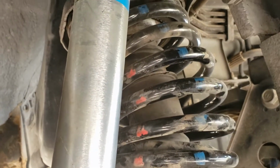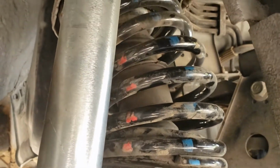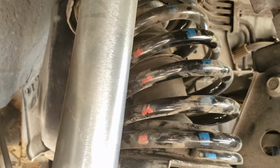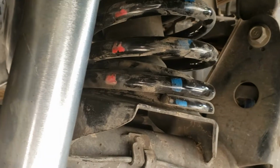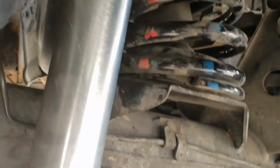With the Nissan Pathfinders, the front part of the bump stop is kind of rubbery soft, and then the bottom half is solid. So it looks like, yeah, the soft part is fully compressed, and now the hard part is on the control arm. I mean the spring perch. See if I can get a better view.